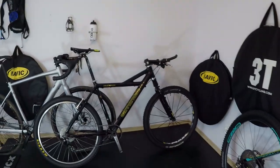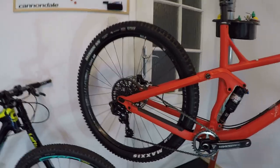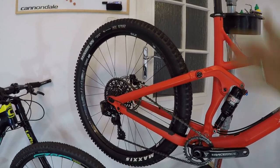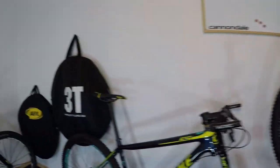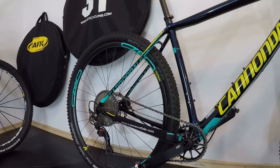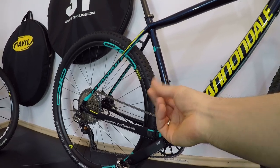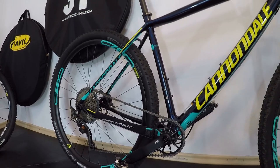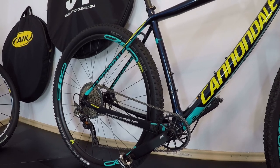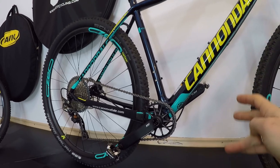To summarize: if you're a weekend rider doing maybe 200–300 kilometers per month on SRAM GX components, you don't need to worry much about wear. But if you're riding a bike with a Cannondale Si chainring and a Shimano XT or XTR cassette, and this is both your training and racing bike, you're going to face real financial issues from drivetrain wear. Just be aware of that.